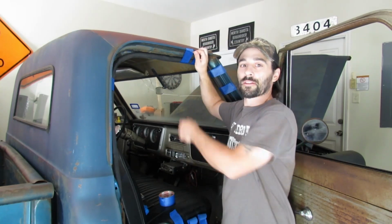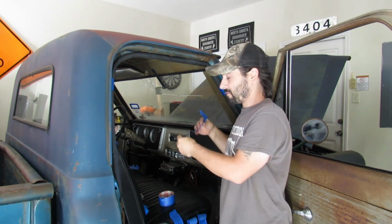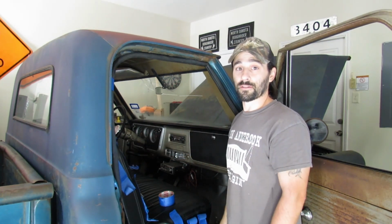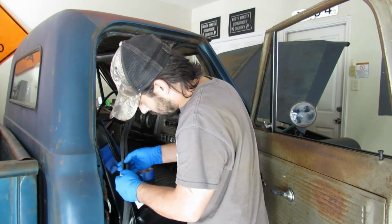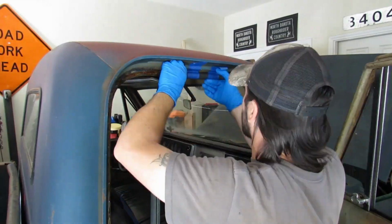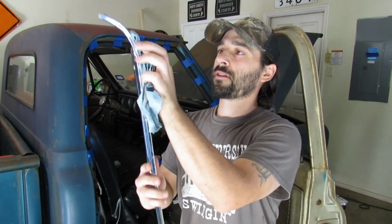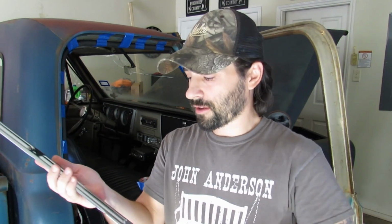It's been just a handful of minutes for you, but it's been hours for me. So I feel confident in seeing if this stuff is cured enough to hold this weather stripping in place. Because if it is, you can get all this done now instead of wait until tomorrow. It did it. It's doing a great job. Let's knock it out. If you've got the threshold off, you might as well clean out underneath it, behind it, prevent that pesky pitting and rust from coming in.